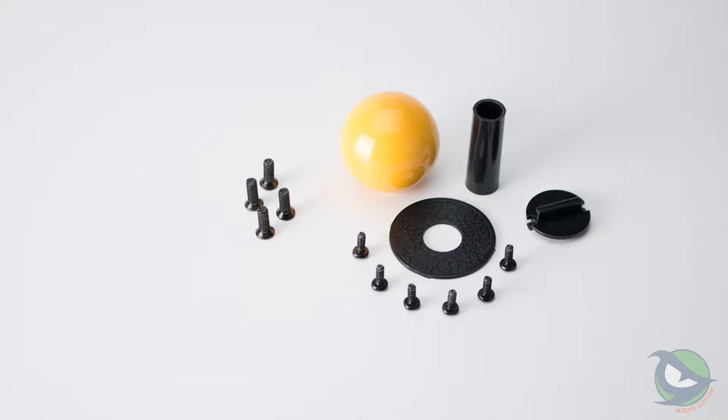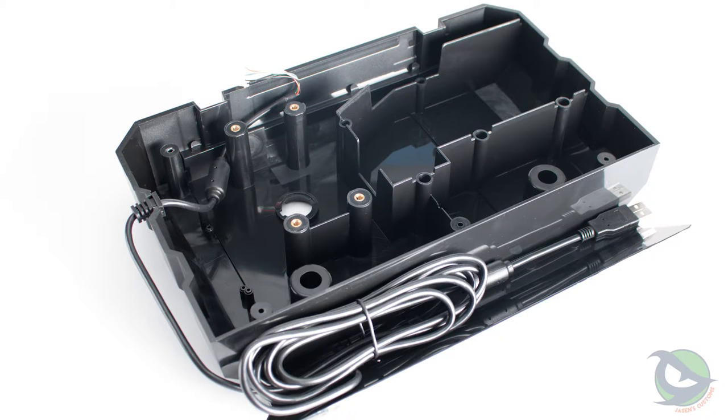As you can see, there isn't much required in the way of tools or time to remove all of the main hardware. A total of ten Phillips screws holds all of the main guts of the stick together. The base of the case is mostly plastic with standard strengthening ribs and posts common to plastic molded parts. It reveals simple cable management for the USB cable, and there is some room to add smaller parts like a Kaimana LED controller, but most of the plastic you'd want to trim away to add parts are strength elements and would weaken the case.